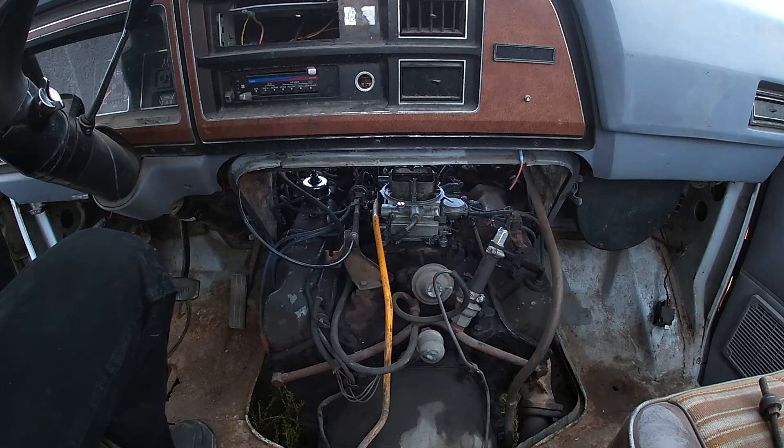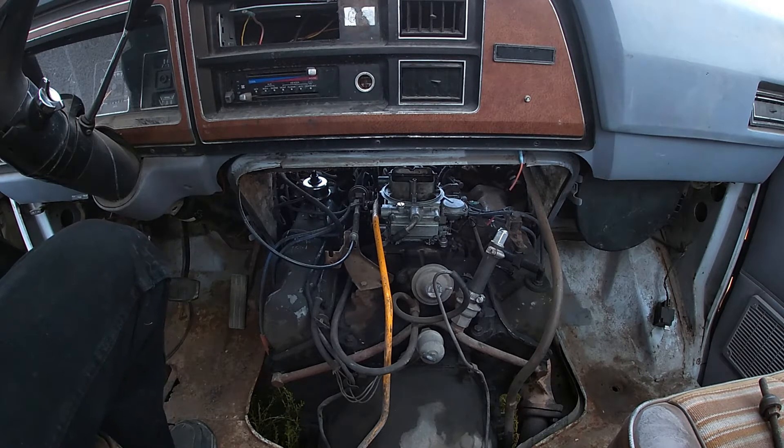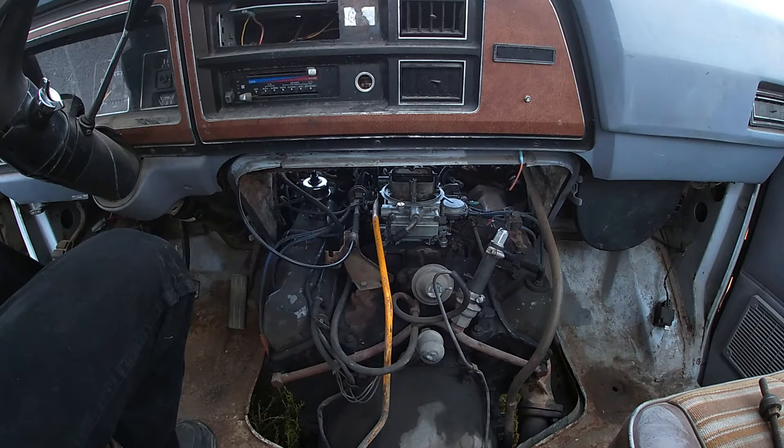It's the next episode of a Flamin 460. The last time it ran pretty good as far as I could tell. Now I notice a little bit of blow-by coming out of the vent tube, which makes me wonder how healthy this engine is. Hard to say. We put a timing chain in it, which kind of tells you something — the timing chain was well worn out, so the engine no doubt has a good amount of wear.